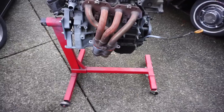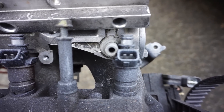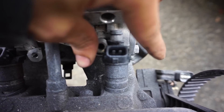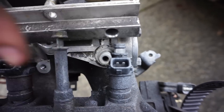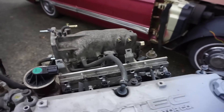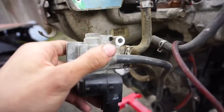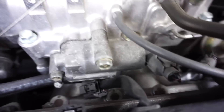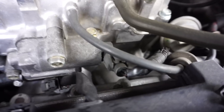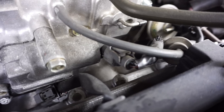This is the old F-series that came out of it. The injectors have the same clips — if it's an OBD2, that's why I decided to use an OBD2 H22. These ones have the push disconnects compared to the older style that had a metal ring. These ones you just squeeze and pull. The other issue is the idle air control valve. The IACV on the Accord is a three pin, but on the H22 it's a two wire at the front of the engine. What I did is I just disconnected the ground wire — I believe it's black — and some people say ground it but I just left it off and that's all you need to do.